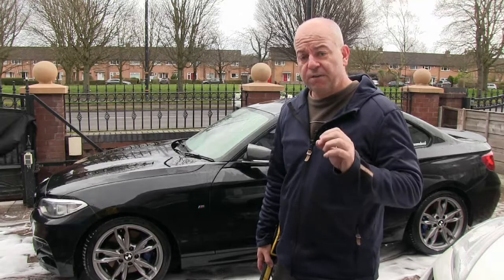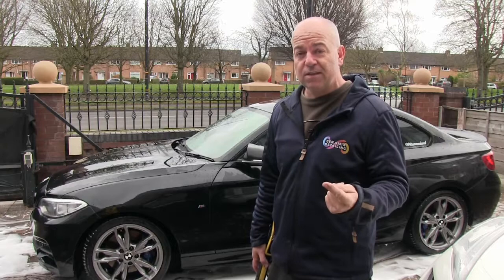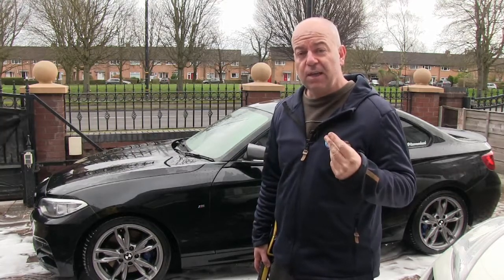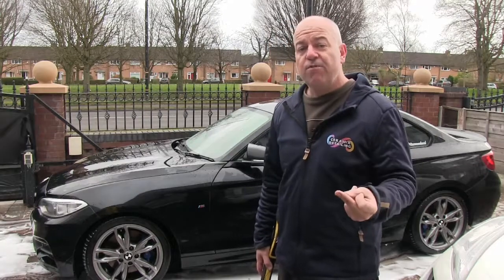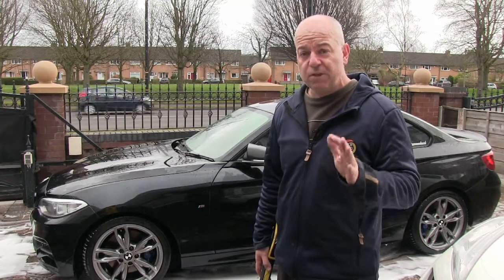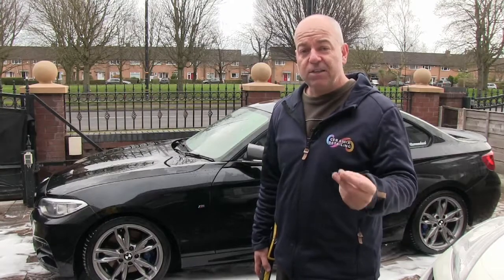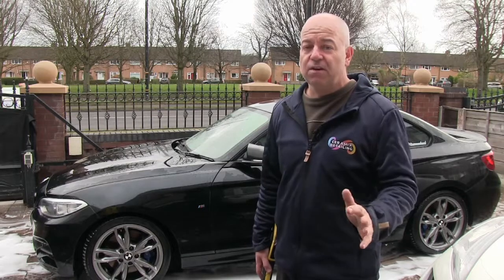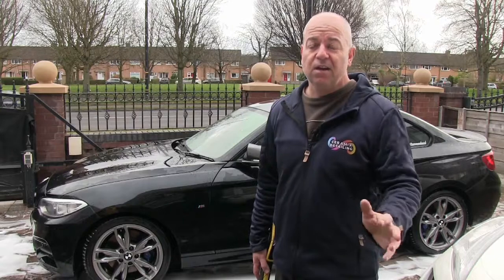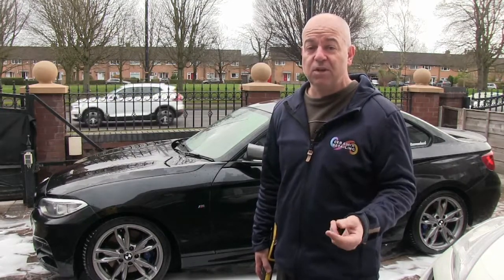That's the BMW power washed off. A couple of final pointers: with any application to a vehicle's bodywork, always make sure the paint surface is cool and try to do the application in a shaded area if possible. Snow foam is used to get as much grit and grime off the vehicle's surface before you go anywhere near it with a wash mitt. If you employ a valet or detailer and he snow foams the vehicle and then uses that snow foam as the actual shampoo to wash the vehicle, get rid of them — none of that grit has come off and it's just being spread around your bodywork, causing swirls that can cost a lot of money to fix. Snow foam application: really easy to do and a very important step to maintain the integrity of your paintwork. Please subscribe to the channel and hit that like button if you've enjoyed the video.